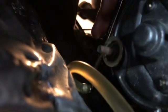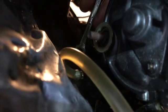Now you gotta also make sure that your hose is on good, because it could be your bubbles are just coming from your hose not being on good, but in this case, we had a ton of air in the system. And look there, okay, so we're just a little spurt. All right, suddenly we are bubble free, so I'm actually going to shut this off and we will repressurize.